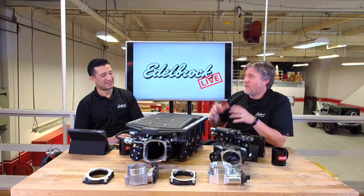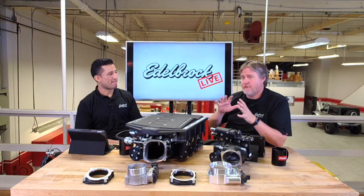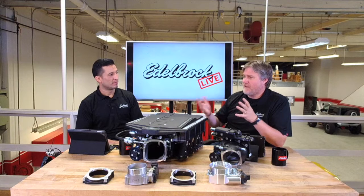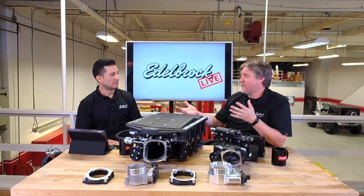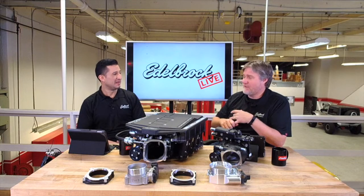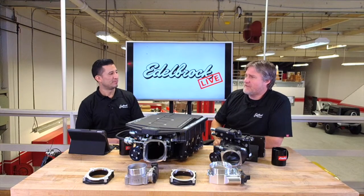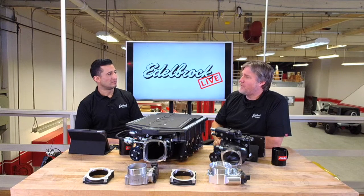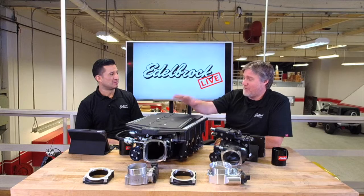They felt 834 was safe for the vehicle to run as a street car or race car. It hadn't gone to a smaller pulley, hadn't really got crazy with it. It had a stock bottom end but stage two cams - so it was an aggressive setup, but really impressive what the potential of this thing is. Now with that bigger throttle body throwing that much CFM with the DP3C and the 2650, a thousand horsepower is not that far away.